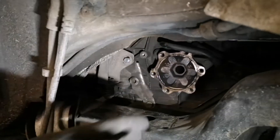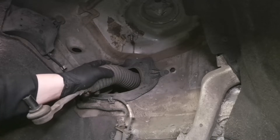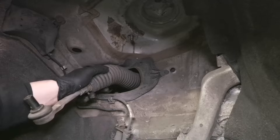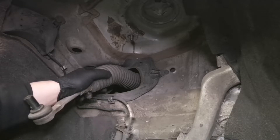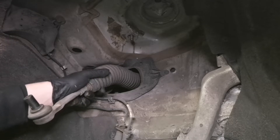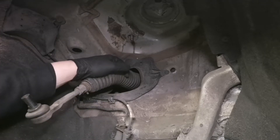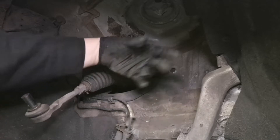I've put a bolt in this bracket. I'm not happy — I can't find anything wrong with it, really frustrating. The driveshaft I bought is for a manual car and it's slightly longer, so it must be slightly different as this is an auto. My CV joints look spot on to be fair, so I don't think it's that. All the ball joints look good, all the bushes look good. The subframe looks okay as it's rubber mounted. I'm beginning to wonder if this fault is inside the diff or gearbox — I've had a diff fail in the past on a front-wheel-drive Calibra and it was making similar intermittent clunky noises, and obviously the gearbox being relatively centred in the vehicle, you could hear that in the cabin quite a lot, giving the impression it's coming from this area.